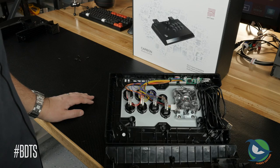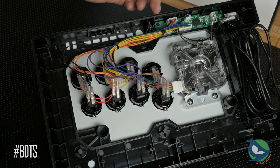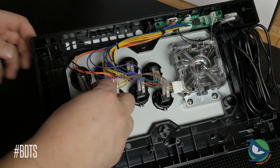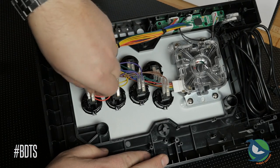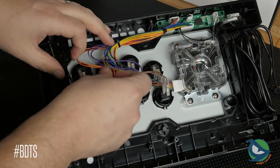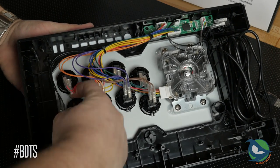Once you look inside, you will immediately notice that all of the buttons and the lever are Qanba original parts — not surprising given the low cost of the stick. The PCB at the top is the hub for the stick and easily accessible. Removing buttons is straightforward: remove the wires and simply squeeze the tabs to pop them out. You can easily swap in Sanwa or Seimitsu buttons into the Carbon since it uses basic 30mm holes.